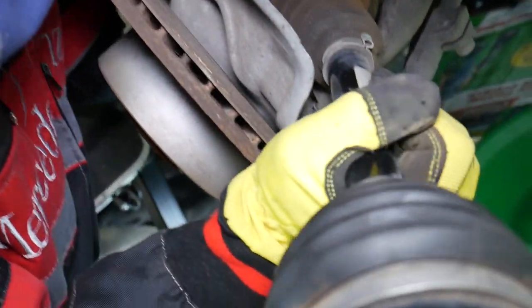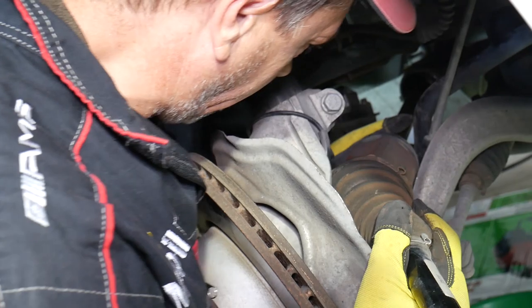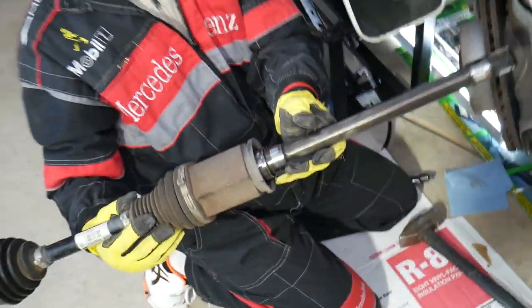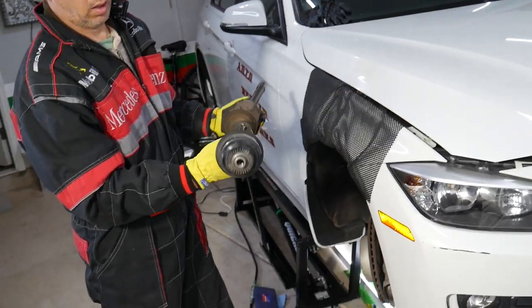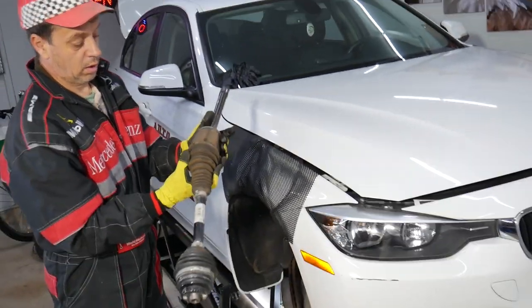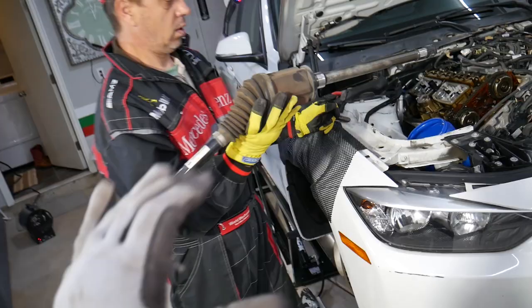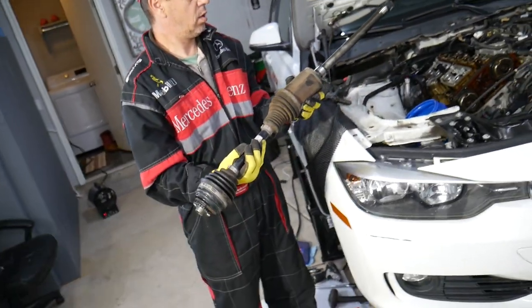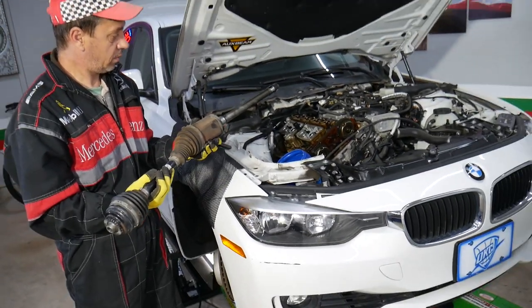Okay, lift it up a little and it comes out of there — careful not to mess up your CV boot or anything like that. And your front CV axle just came out like that. This is the front right side, out of the car. That's how you remove the CV axle shaft on the passenger side on BMW F30, F31, F34 all-wheel drive. Hopefully the video will be helpful. If you need to buy a new one, I'll share the part numbers and the link in the description. Putting it back together is basically in reverse order. If you need differential oil, I'll put the link in the description as well. Thank you for watching — please subscribe for more help, and see you guys next time.